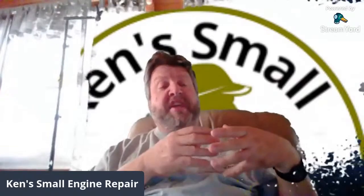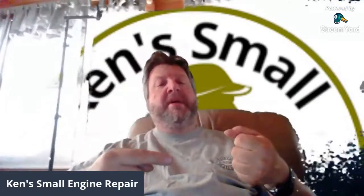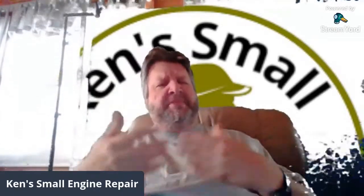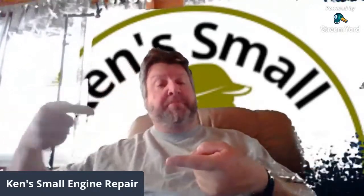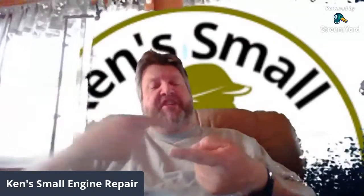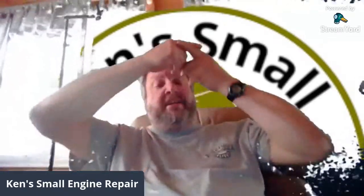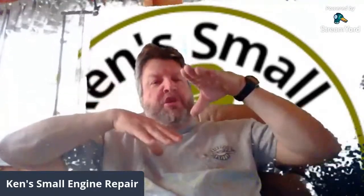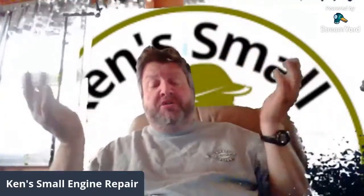I don't know if you guys are familiar with AYP Husqvarna tractor steering systems. There's a steering column, and on the bottom of the column, it gets supported by a bushing, either plastic or bronze. A lot of times it's plastic, but sometimes they're powdered metal bronze. What holds that whole steering column up is a pin. It's like a D-shaped or P-shaped clip that fits into the steering column. That pin rests on the bushing and literally holds that column up. When that pin breaks, the column falls, the sector gears don't mesh anymore, and you lose all your steering. So Ali, maybe it's something as simple as the pin. Who knows? Hopefully that'll help you.